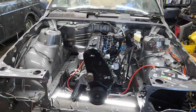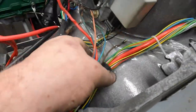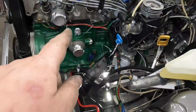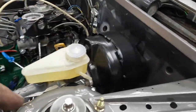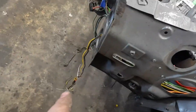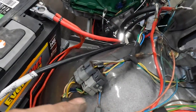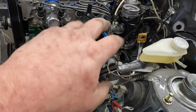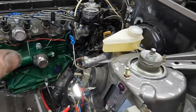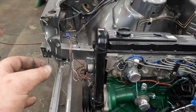I'm not going to film this part because it's going to be tedious. With those all cleaned up and laid in, you replace all your zip ties. Mark each branch with a piece of tape — just makes it easier to wrap up later. The first harness you're going to put in is this big guy with the big connector down under the dash. That comes along the pilot side strut tower, giving you front to back — horns are down there. These headlights, the turn indicator, the parking light, all that. That also plugs into the second harness, which goes down and makes the engine think and talks to the cluster. The third one comes out from the feed-through down behind the injection pump and runs your overheat fan and a few other things.